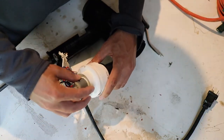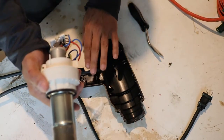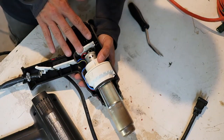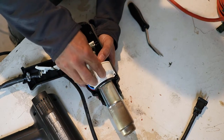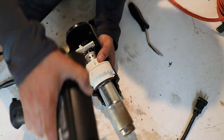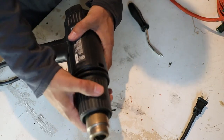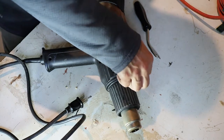Now I'll bring back the blower assembly and insert that into the housing. I'll drop this all back into the lower half of the plastic housing and line everything up into the grooves. All of these pieces have a slot or a pin, like on the blower motor, that they drop into in the lower part of the housing. Now that everything is seated, I'll bring in the top part of the housing and snap it in place, then bring in the collar and screw it back on the front, and reinstall the five screws that hold the case halves together.